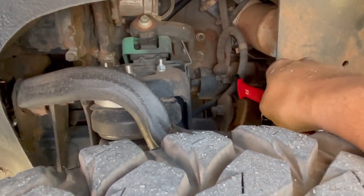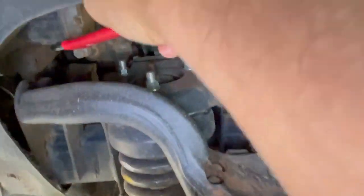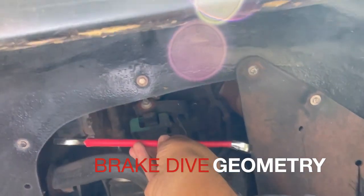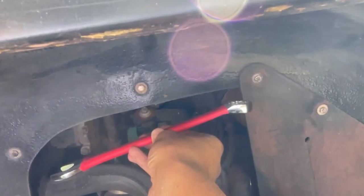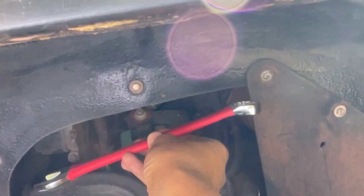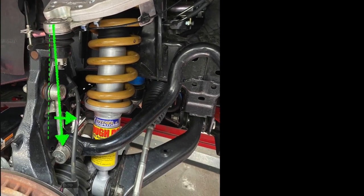Now notice how the upper control arm is mounted on the body — the front end is higher and the rear connection is lower. This upper wishbone or A-arm is inclined with respect to the horizontal. This is called brake dive geometry, provided because when you slam the brakes the front end nose dives and all the weight mounts on the front suspension. This inclination counteracts that brake dive effect, with the inclined UCA giving a reverse reaction to the nose-diving vehicle. As a result, the upper ball joint will not move purely vertically during wheel travel but will move with a slight forward bias.